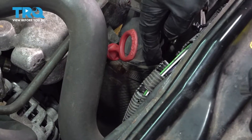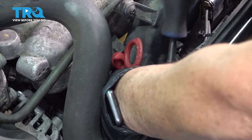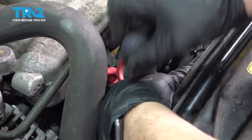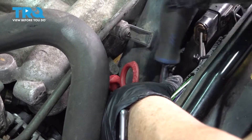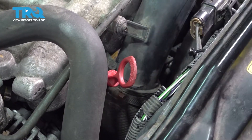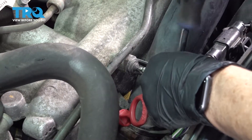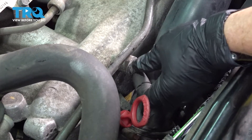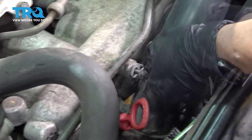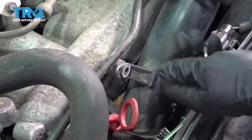I'm going to follow the tube right to the front here, and at the other end of that air dam hose, I'll use a 7-millimeter socket to loosen this clamp up. This has a little mounting bolt — it's a Torx head, T25 — so we'll get that and take it off. That's a T25 Torx bit head. It has a long bolt. Now we can lift this right up.